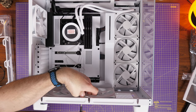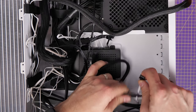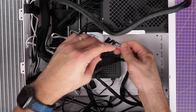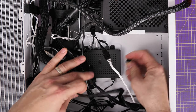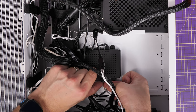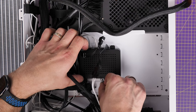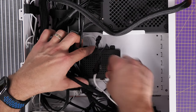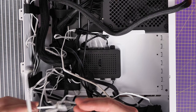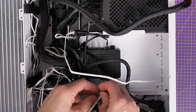I've done a video separately on fan setup logic and things to avoid — just follow the same process here since hot air rises. Run the fan cables to the rear and plug in both power and RGB connections. If you're installing a lot of fans, note you can only use six RGB connections and nine fan power connections on this controller — but you can also use the NZXT RGB connectors and system fan headers on your motherboard for more. You could add push-pull, more RGB fans, or swap the non-RGB rear fan for an F120 RGB fan.